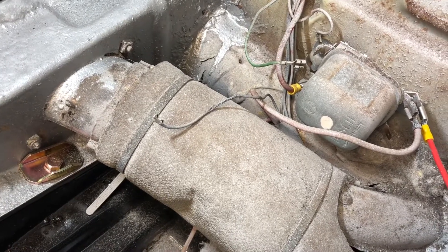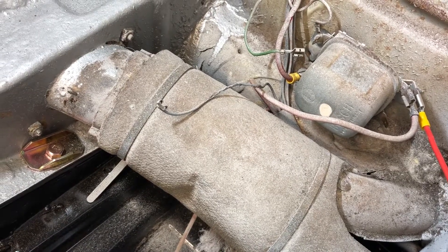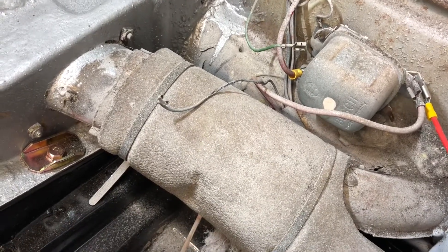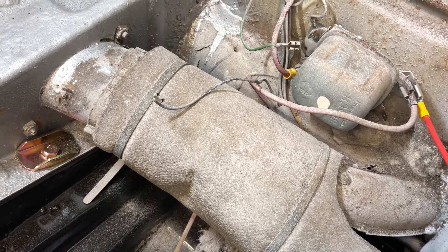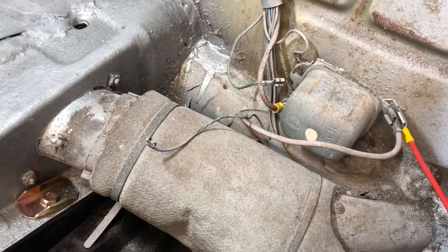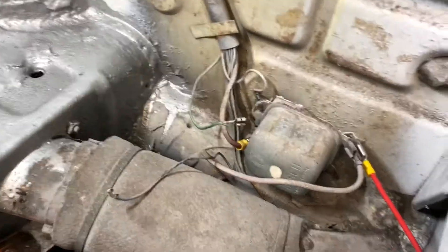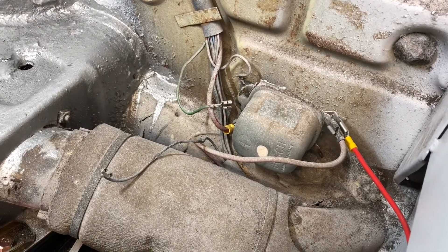I'm going to snip it off as far back as I can into the harness and put a connector on so I can connect it to the green DF for my alternator — but this was my charging system problem, not the generator I just walked through replacing. Let me stress: here I am, an experienced technician who should have known better, and all I needed to do was proper diagnosis. Don't miss the obvious, don't jump to conclusions. I did spend a bunch of money and time replacing something I didn't need to replace — but now I've got a better charging system than I had initially, so it's all good.